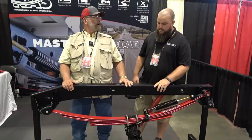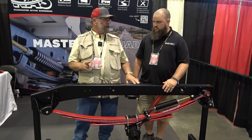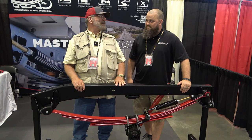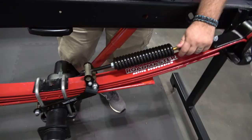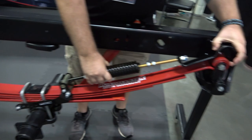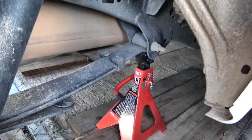You just saw the Roadmaster controlling the factory leaf spring — that's what it does. It controls the leaf during wheel hop when the axle is trying to bounce and go sideways, and controls axle wrap — that's the driveshaft, universal joints, and pinion all torquing too much, creating too much angle because of those leaf springs bending into a big S. It actually bends the factory leaf springs going through axle wrap. Installation is very quick — I think I did it in 30 minutes. You install it to the eye in the front, the part goes underneath the leaf springs, and this part cups back over by the shackle, the hinge.